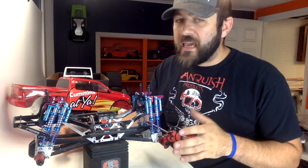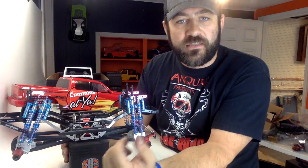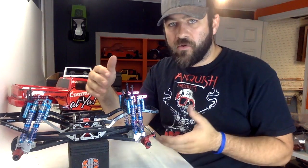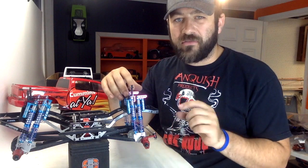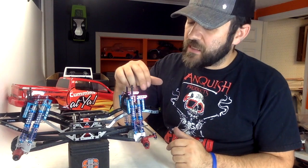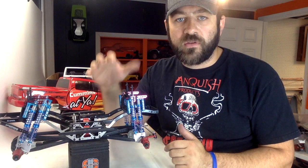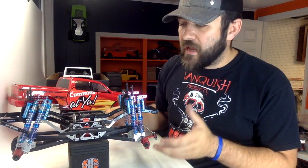The installation of all eight RC Four Wheel Drive King shocks is complete. In the rear I laid them down a little bit further, and in the front I stood them up a little bit more — just a bit of performance thinking. The rear will have a little bit more travel than the front, since the front has to deal with steering and will have bumpers and body in the way, so limiting that front travel just a little bit more was something I was comfortable with. I'm using the CBERC shock keys to tune in where I want these shocks positioned, and in the end I'll actually build a shock mount for the front and rear and likely tie in some other work at that point.